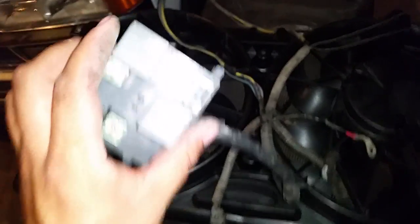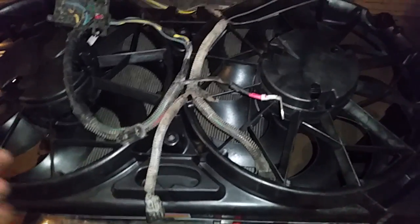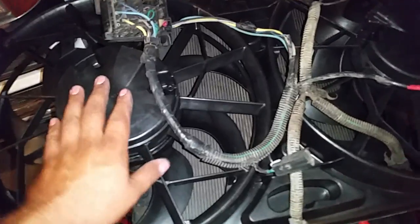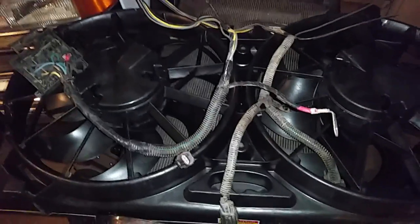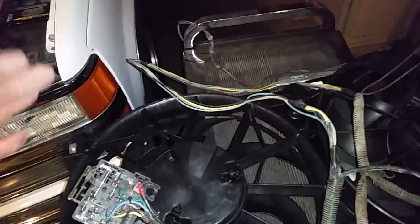You get a six-pin that's kind of offset there as well. You're going to get 700-watt motors with a seven and nine blade — they call it rimless — but you cannot get the harness that goes originally to these 09 Caddies or 07-and-up, because what happens is you don't get the relay assembly. You'd get basically a harness that plugs into a one-size-fits-all fuse box and relay assembly kit — it's not going to work for you.